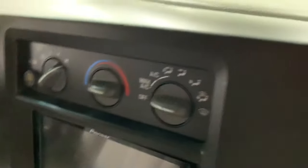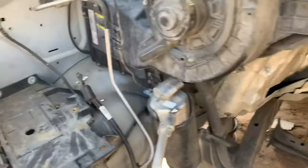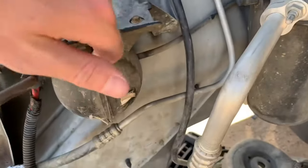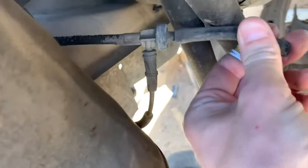On this van it's not making that noise. This is the location of the HVAC check valve. You can see on the front your battery would be sitting right here, and then it has the vacuum reservoir down underneath. If you trace that line back, you can see that it goes behind the accumulator and your check valve is right there.